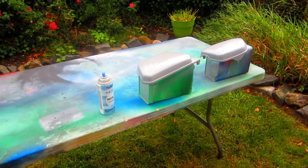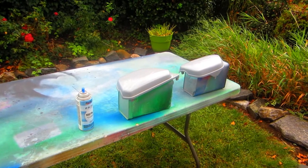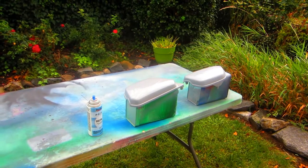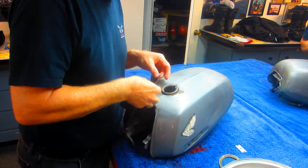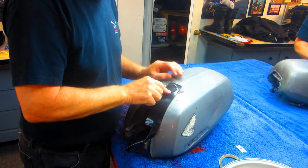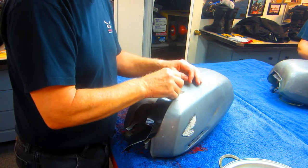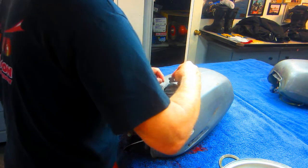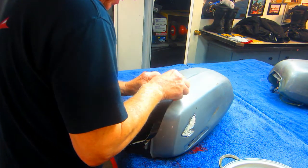While I'm waiting to get another coat of primer on — I want at least three coats to really seal that underlayment — I have about 20 to 30 minutes so I can do some body work on the tank. I have some Gorilla Tape to seal up the gas tank. When Ray was up here we tried to remove the petcock and it looks like you need a very thin-wall 8mm wrench to get in there, which I didn't have. So I'll just back-mask the petcock.